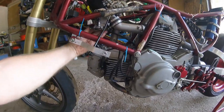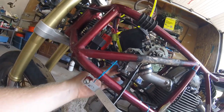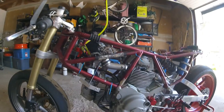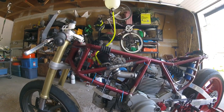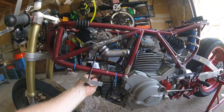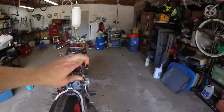So yeah, there, it's sweating a bit. I'm not sure if it's in the float bowl. I hope it's not there. No, I don't think it's there, but I'll just replace that float or check that float bowl gasket again. But yeah, I have to go through the carbs and do something with jetting, because it's set up for a 400, not a 680. So hopefully I don't chase myself too much in circles trying to get proper jetting for this configuration. I don't think I will. I think I'll be able to come up with something that works. So anyway, promise, pinky promise, it was running.